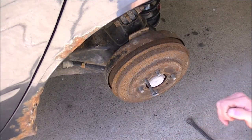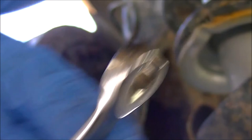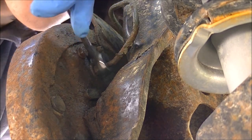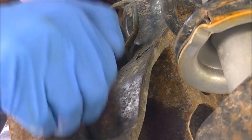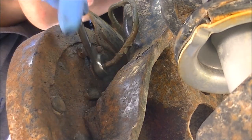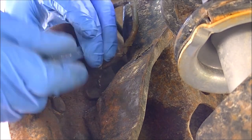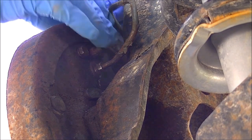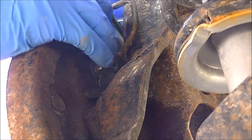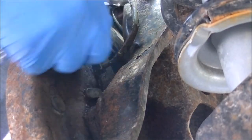If you've ever done a Mazda 3, it's just hitting and hitting and getting nowhere. Now we're going to remove the drum cover to expose everything. Using a 10 millimeter open end flare nut line wrench, I'm going to loosen the brake line just a bit, giving it some taps to see if it'll come free. It doesn't look like it's binding on anything. I'm going to loosen up the wheel cylinder bolts, giving it a couple of taps — there's one, there's two loosened. Everything is loosened on the back side.